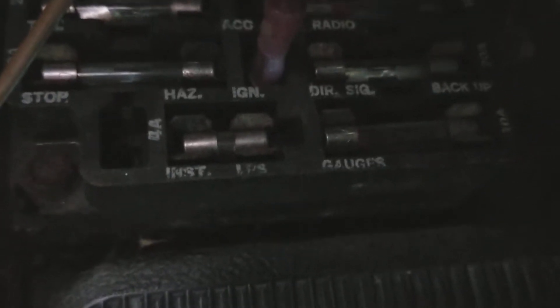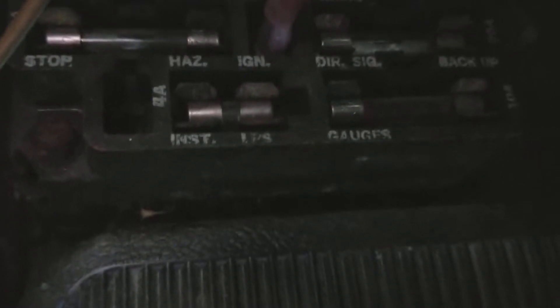It's probably low on gas. But remember that 12 volt source I was telling you about — that's where a lot of people have a problem. When I rewired my Mustang I had that issue too. The easiest way to do it is if you have a fuse block and it says IGN — that's your ignition. Use that as your 12 volt source. If you can find that in your fuse block, that's the easiest way to get your 12 volt source to start, crank, and run everything.